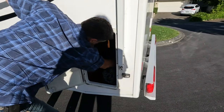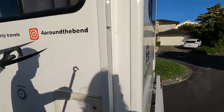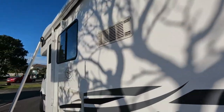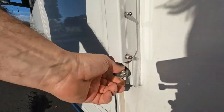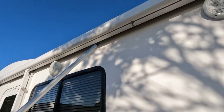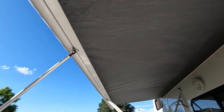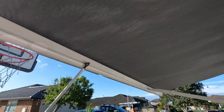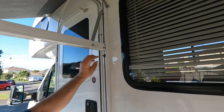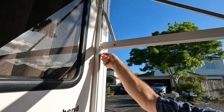To use the awning, you will find the awning pole in the garage at the rear of the van. First undo the wing nuts at the bottom, then there are latches at the top that hold the awning in place — same on both sides, top and bottom. Most importantly, because it is such a large heavy awning, you must support the weight of it when you get to the tipping point. Use the pole to support the weight as shown, then let it down gently. Redo up the wing nuts just loosely to secure, not too tight. The most important thing is supporting the weight of the awning so that it doesn't damage the side of the van if it drops.